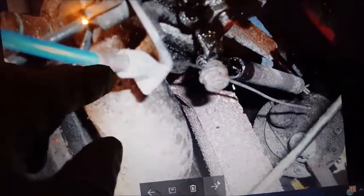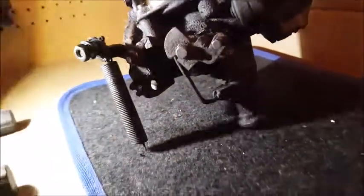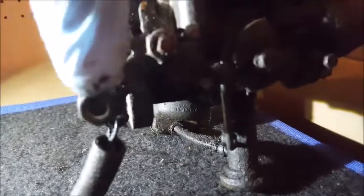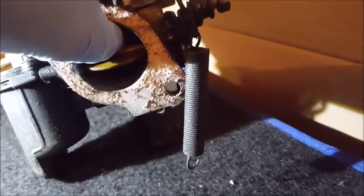Next thing I detached was the accelerator cable. You can see a picture here of it all attached. It goes through a mounting bracket, onto a nut which has a spring. The spring hooks onto a bracket on the manifold. I can show you on the actual carburetor here — the throttle cable attaches through here. This nut just unlocks, relieves the tension, the spring unhooks. When the cable pulls the throttle, it opens up the butterfly there and allows the air into the engine.